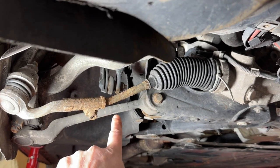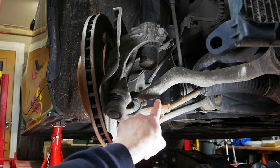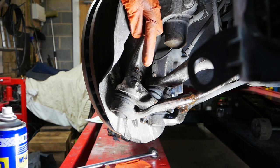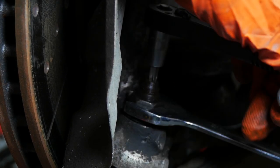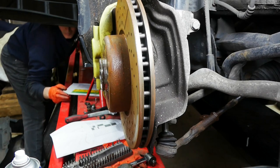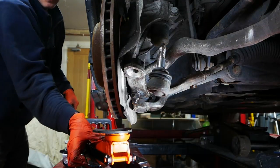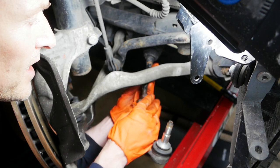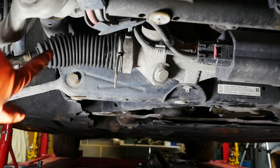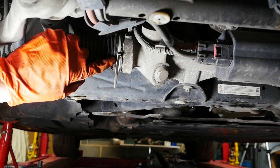In the last crashed BMW video we saw that the steering arm had been damaged in the accident, so let's get this track control arm off and get it replaced. The first job is to undo this nut, and with that done we can attach the ends of the shaft for the ball joint and that will push it out. I plan to just replace this and remove it from the car as a complete unit. Normally where the inner track rod meets the steering rack you would have a proper boot clip on that - I've only got a tie wrap.